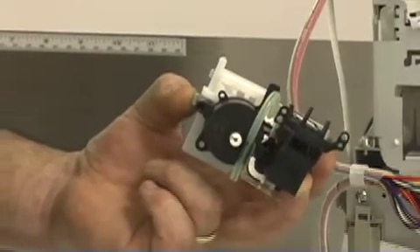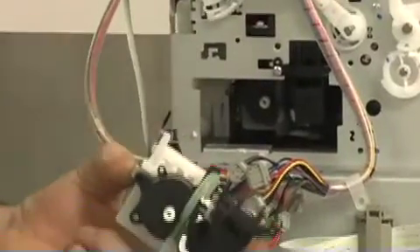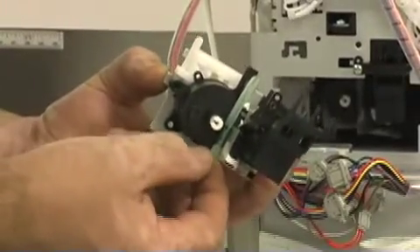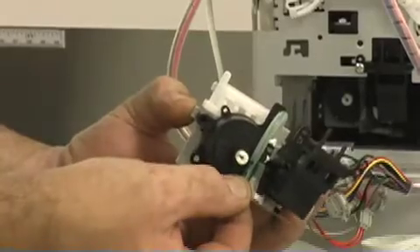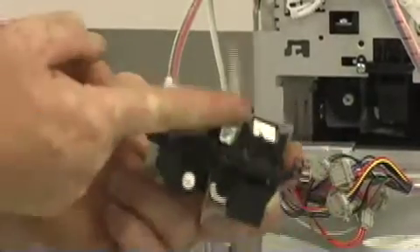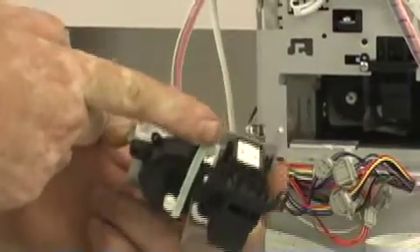This is what your capping station and pump look like inside the machine. It's located directly behind that splash guard. What you want to do is reach inside and remove the hose from the little clip that's on the pump. Just pull it gently towards you like this. Now your hose is free to attach the other hose to.